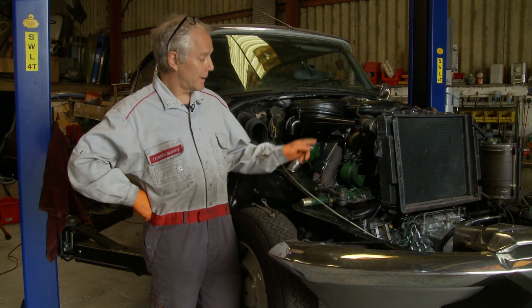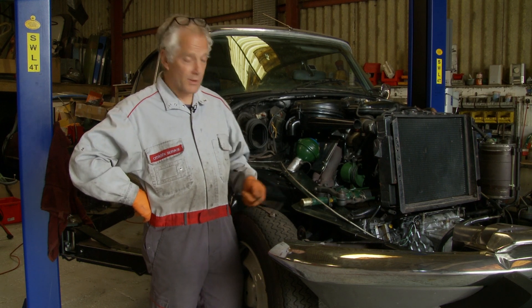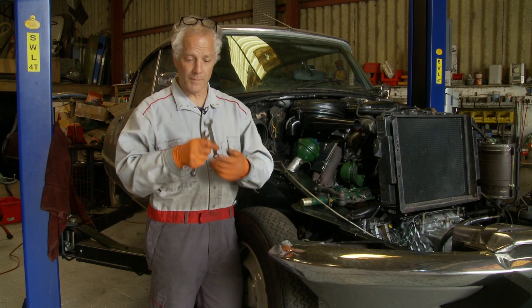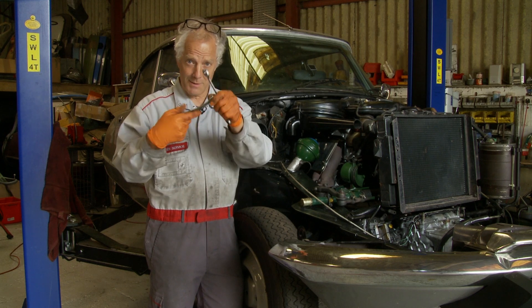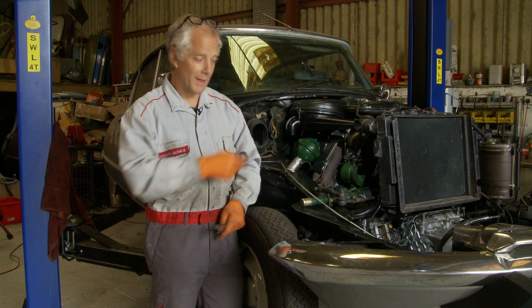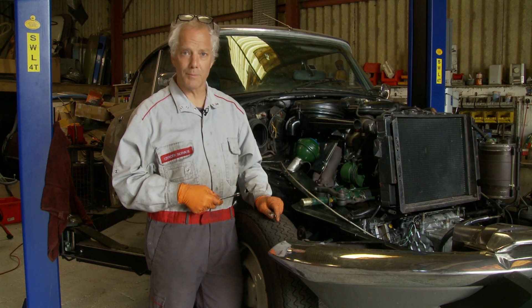Being a Citroën, it's completely awkward to get at the pads, and in order to do so you will need to get yourself a special tool, which is one of these. So you take a perfectly innocent 14mm spanner, and you grind it down so it's nice and slim at the end, and then you bend it to make life easier, and then you take a notch out of it here.